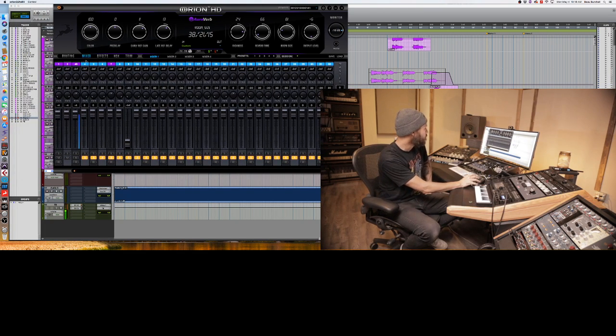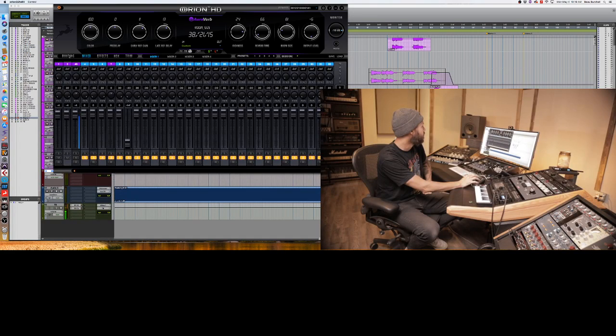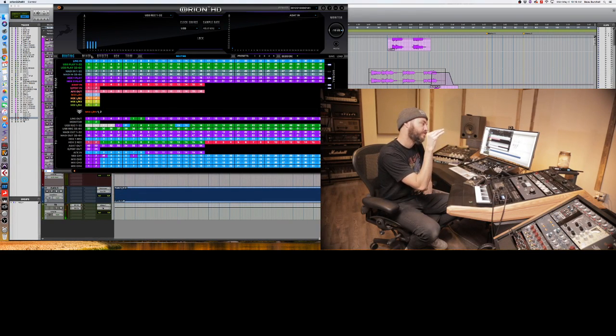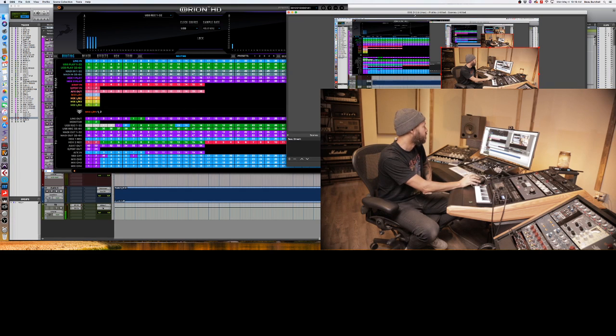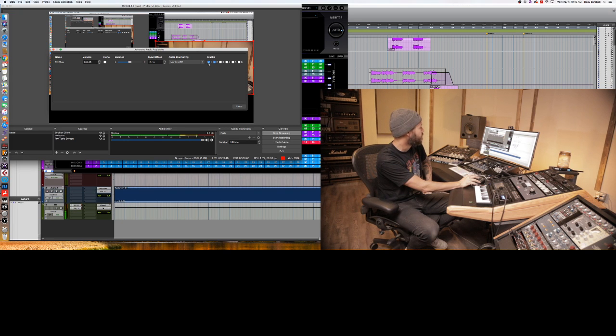So now out of the mixer, you can assign the routing of mixer channel one and two to USB record one and two. So now the output of this mixer is being sent to the USB side of the Orion. So as I'm streaming in OBS, hopefully this doesn't cause a huge loop, but I don't know if I can even open these up right now. Audio properties. So now this shows the audio side of what's streaming out of OBS. This is USB 1 and 2.